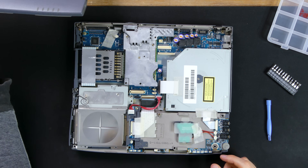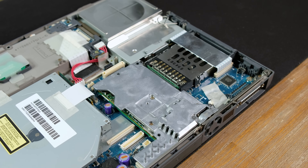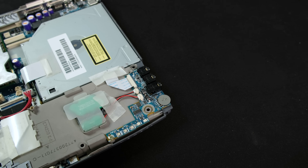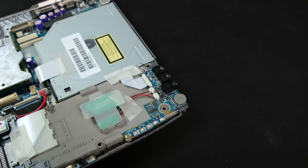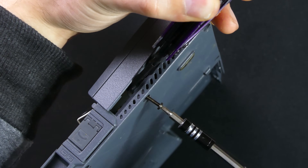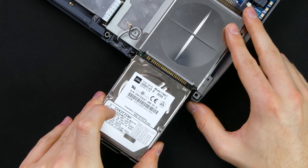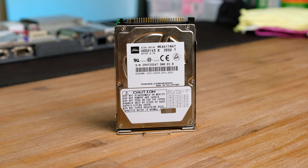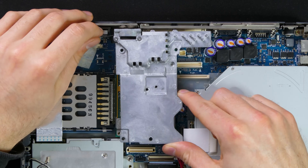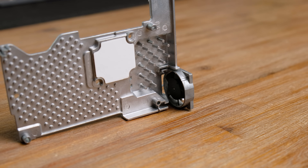This is what the internals of the laptop look like. The processor and heatsink are on a daughter board that connects directly to the motherboard, meaning you could technically replace this CPU. It's good to see that the capacitors don't appear to have bulged at all. It's very modular with lots of easily removable parts. The screw holding the hard disk caddy in place wouldn't come out, so I gripped the nut with a pair of pliers. With all screws removed, I slid the IDE hard disk out — it's a 4200 RPM, 6.4 gigabyte Toshiba hard drive. Removing the CPU heatsink was next; it's quite a solid piece of metal and came out easily after unplugging the fan. There are several metal fins next to the exhaust fan to help with cooling.